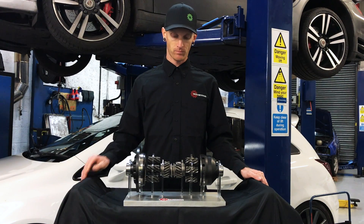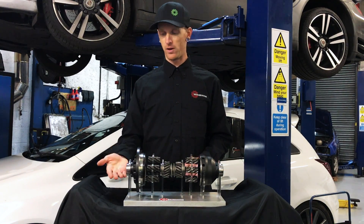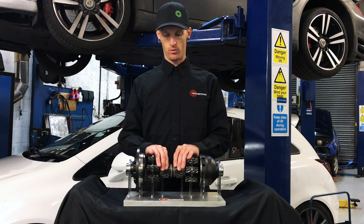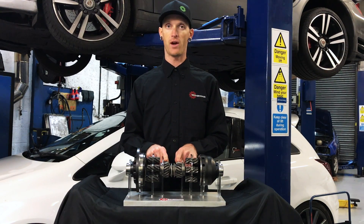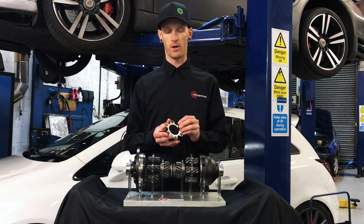How we overcame that is with our wave hub. What this wave hub does: when you get wheel slip, wheel lift, or wheel spin, it senses it and begins to load or ramp on the wave hub and side gear, forcing the side gears outwards, pinions outwards, into our second piece, which is our steel bias plate.